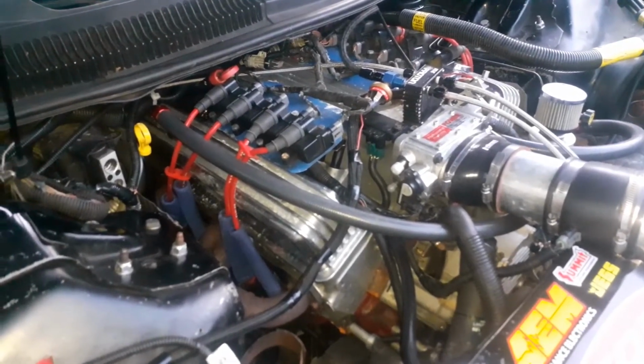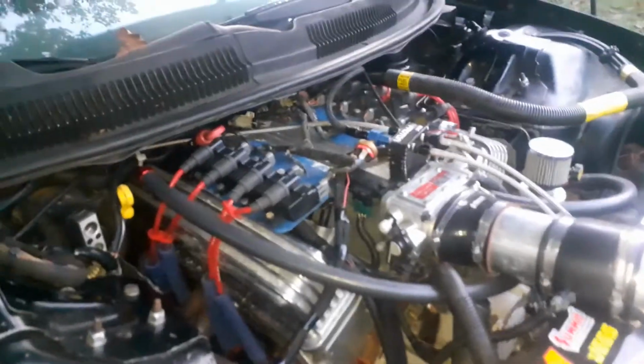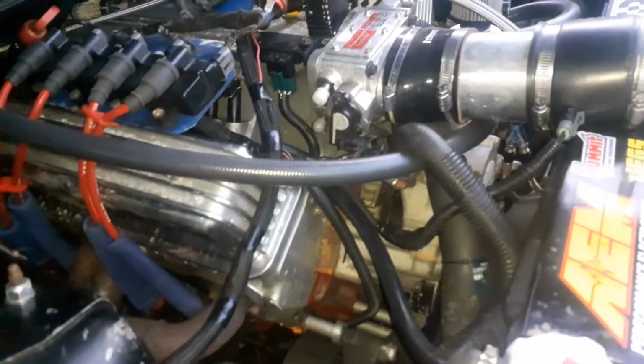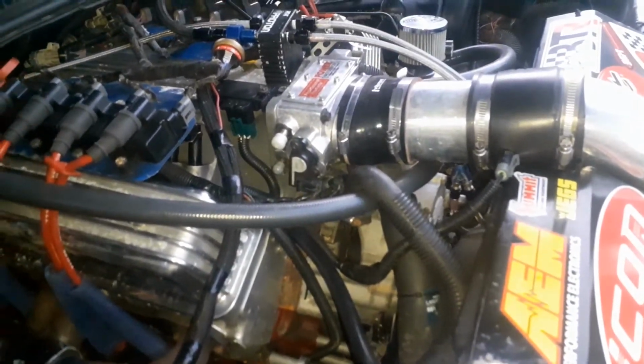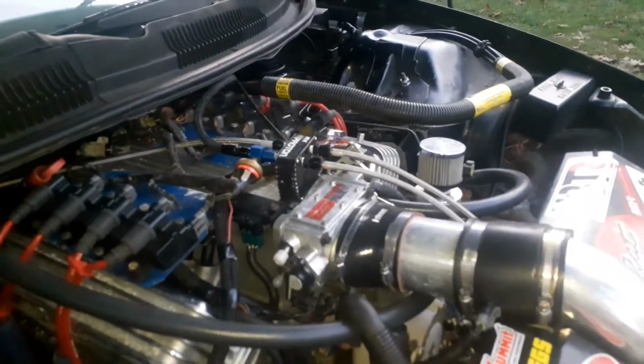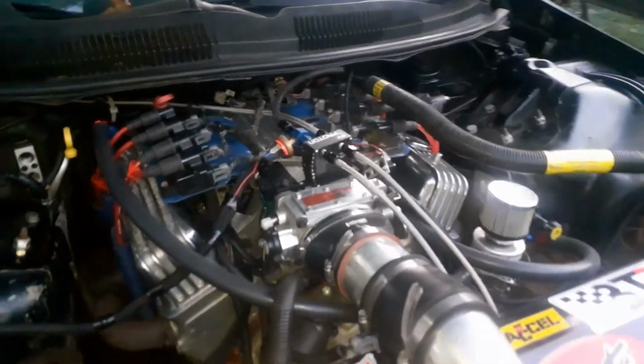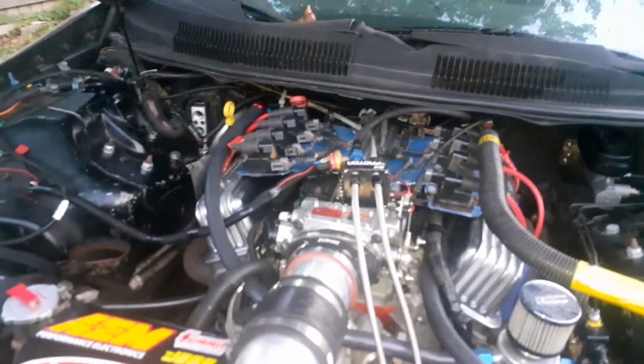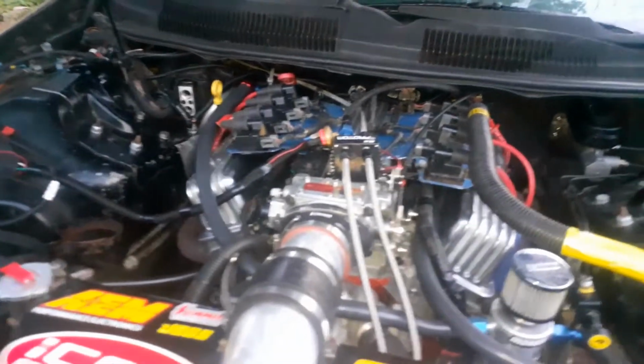No more messing around. We're going to put a Turbo 400 in it. And I'm also going to go ahead and change the crank sensor too. I bought a $100 one that's supposed to be top of the line. And I'm going to change the throttle position sensor too, because sometimes when you hit the gas on the log, it like pauses a little bit before it hits 100% sometimes.